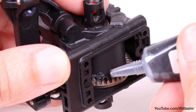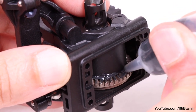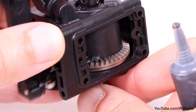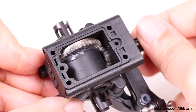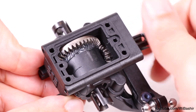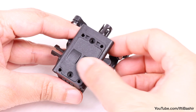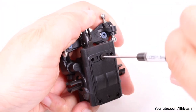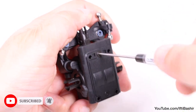Finally, turn the bulkhead over and apply some grease around the entire ring gear. You don't need to go crazy with the grease here — just a small amount going around the gear, as it helps to reduce temperatures and makes the set last longer. At this point, slowly turn the diff coupler as well as the differential itself, just to get that grease spread around the ring gear and pinion and to check everything is turning nice and freely. We can then proceed to seal up the bulkhead by placing the final plastic piece on the bottom, and securing into place using the two 6mm flathead screws, taking care not to over-tighten and strip out any threads.